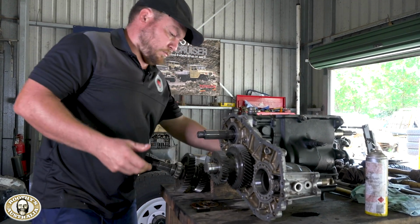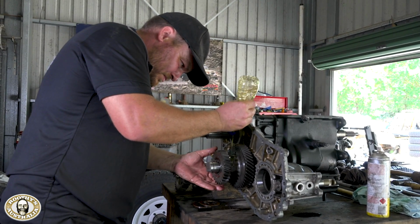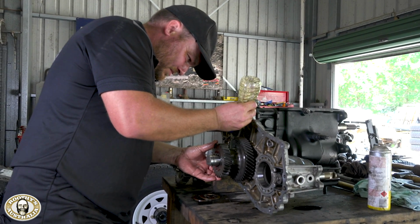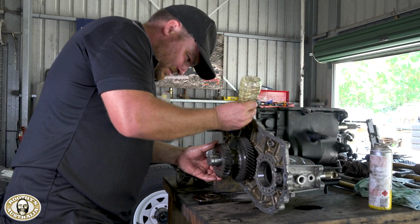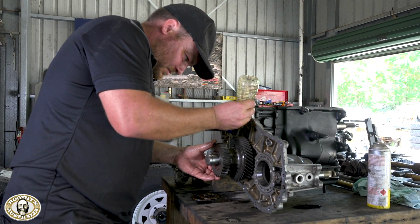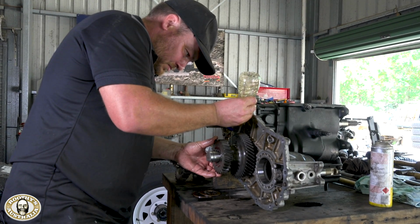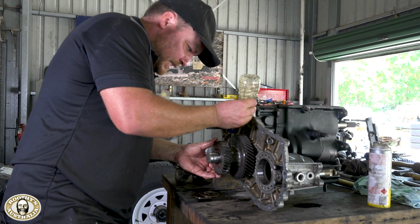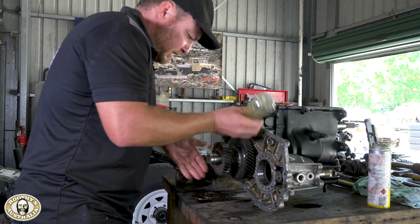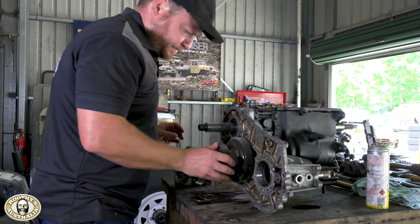So this is the idler gear, which transfers the output shaft drive down to the forward and rear drive shafts through the transfer case. Okay, so basically, it's got the two different size helical gears on it because you select one or the other for low or high range. Low, that's it. That's perfect. This will just feed up that bearing, so when we get first motion, we know we're lubricating. Beautiful.